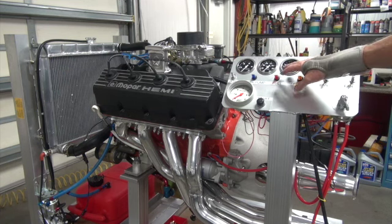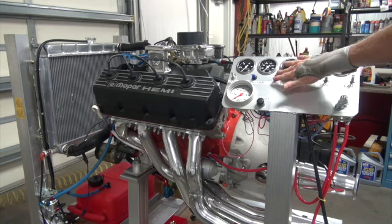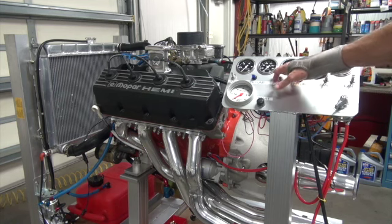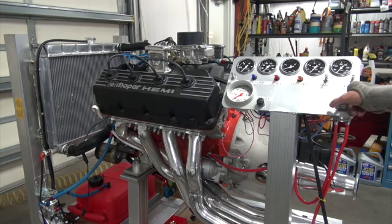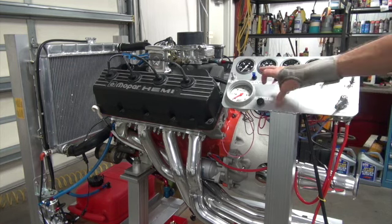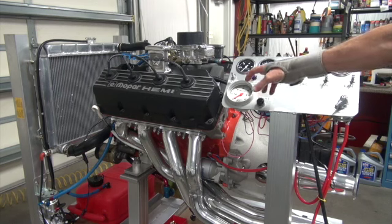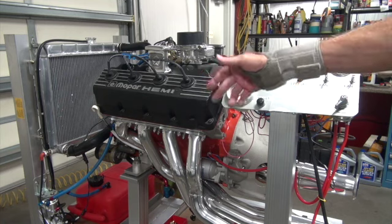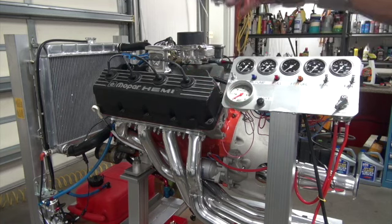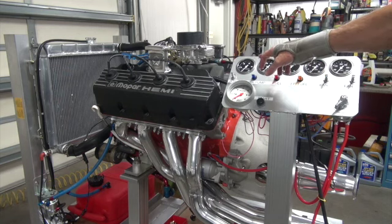Then you've got the fuel. This carburetor calls for 5 to 7 psi, and we've got 6. And then we've got the water pump. Oops, I guess I should put that on. So that seems to be working good. It also has a water heater, so we'll preheat the water. We're not going to have to do a stone cold start. And I primed it again,